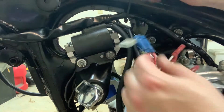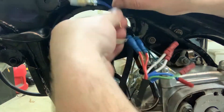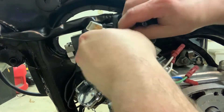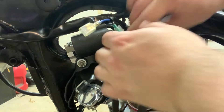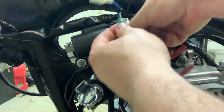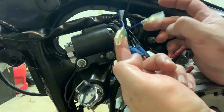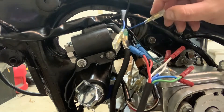Now, what you want to do is look at each of your coils. Each coil has this double connector, and one of these is that black and white wire. This black and white wire is going to go into the double on the same one we just tapped into, and there's going to be one coming from each of your coils. So I'm just going to grab and reach around, grab this one, and do the same thing — fill up our double bullet connector right here. There's not much slack on this one at all. I'm going to have to twist it around just a little bit, being mindful of all my different connectors. So that's it — now all we're looking at are our two remaining blues. I think one of these is supposed to be yellow, so this is essentially my right side.